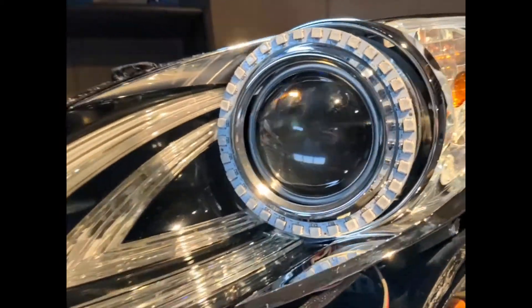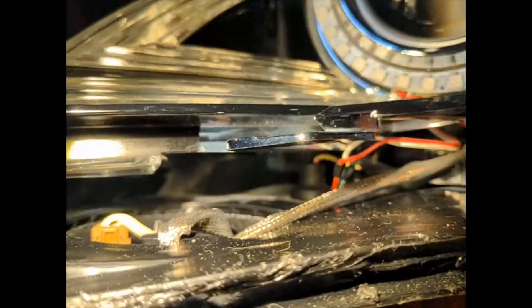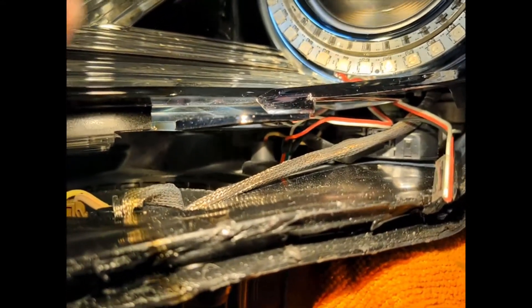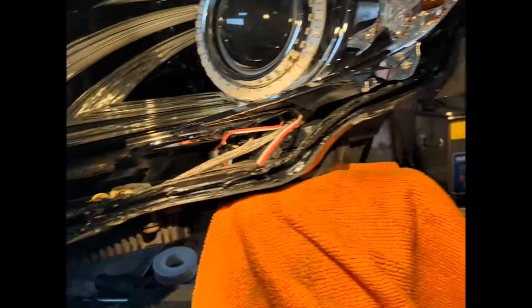This ring has an input and an output. Each one is three wires: 5 volt, ground, and signal. The input to this ring I have snaked through the side of this boot. Mazda has this boot back there — the thing with the yellow wire hanging out. They have a bunch of wires potted into there, and I am just shoving my three wires alongside of that. I figure if I do that and fill it with grease, it should be pretty waterproof. So that's our input from the outside world into the headlight housing.